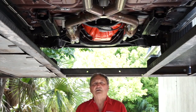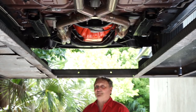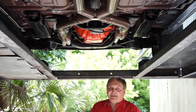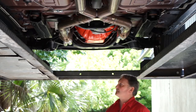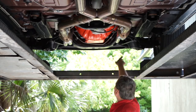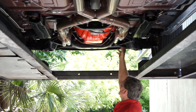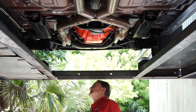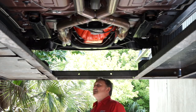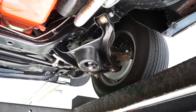This is the undercarriage of our 1974 Z28 Camaro — real Z28. I'll just tell you everything is new and try to point out what I can see. Everything on this car is literally as it was when it was new in 1974. You can see the front spoiler isn't even disrupted in any way. Brand new steering box, brand new Pittman arm, brand new idler arm — still have the zinc chromate cadmium plating on them. Tie rod ends, all new. All joints new. Everything on this vehicle is absolutely just the way it was when it was new. New shocks, new springs in the front, new backing plates, new rotors, new calipers, new associated hardware. The A-arms all have new bushings in them, top and bottom.